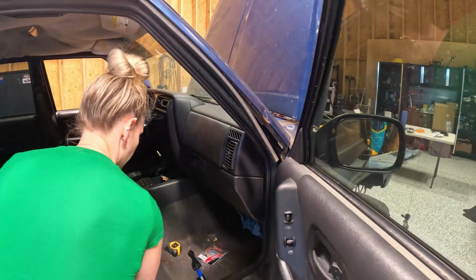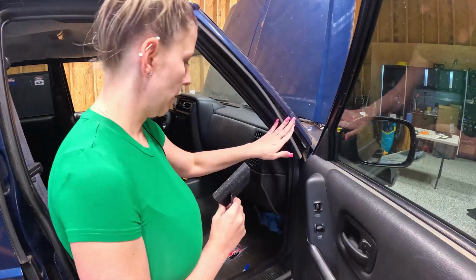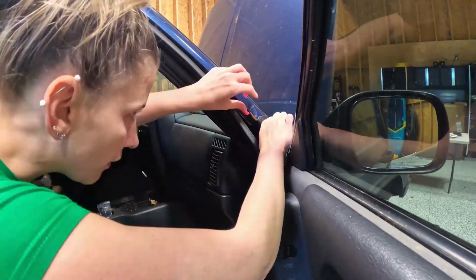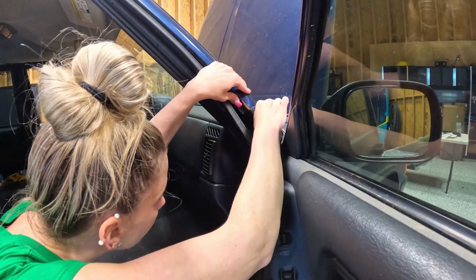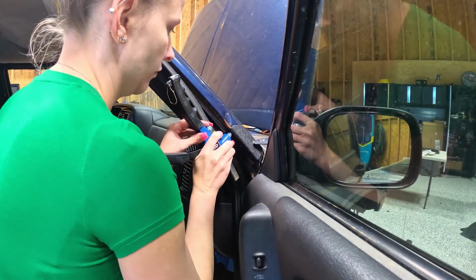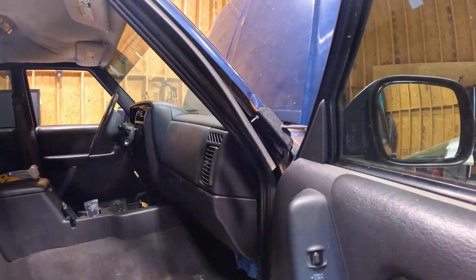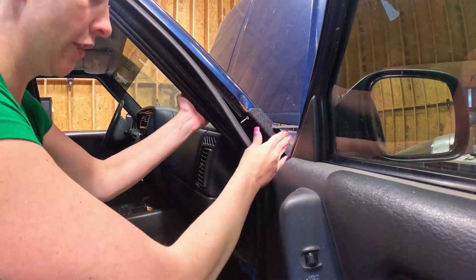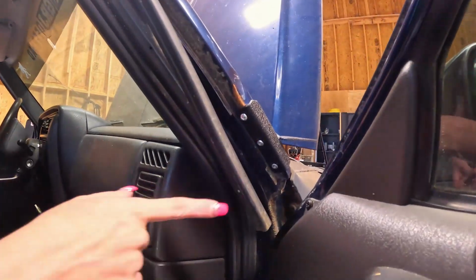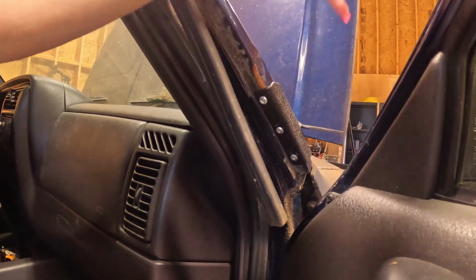All right, so the back of this bracket is a foam piece I'm gonna put on real quick, and then we'll put it on with a pop rivet. We're gonna put the pop rivet in the top. Really, you should use Clecos, but we don't have any. Then we're gonna drill out these two holes and put two more pop rivets in. All right, all three pop rivets are on, and now we're gonna place the light onto the actual bracket.